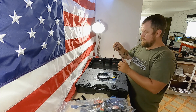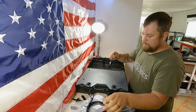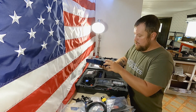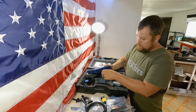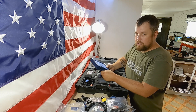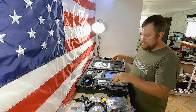It also comes with a grounding strap. What this grounding strap is for: if you've got an issue with a vehicle sending strange readings through your scope, you take the screw out, put this on your screw, and then ground it to the chassis ground. That way your scope is grounded and you don't have any strange readings from any type of back feed issues.